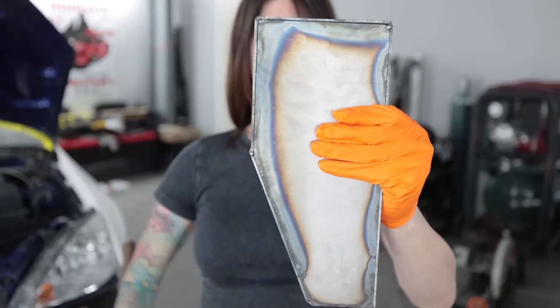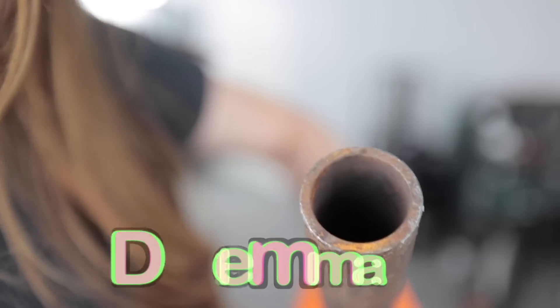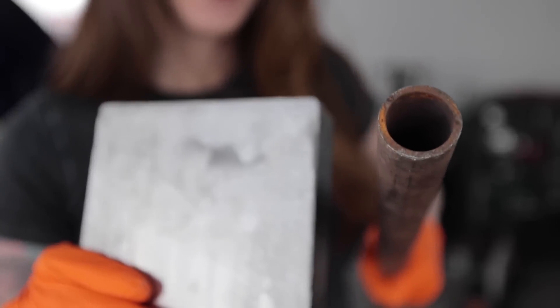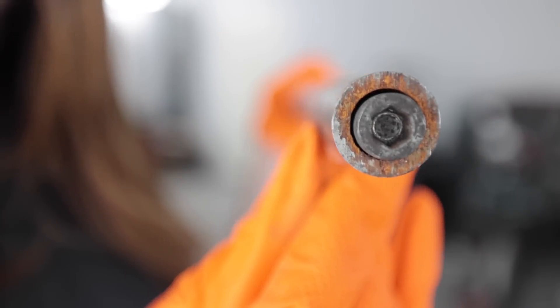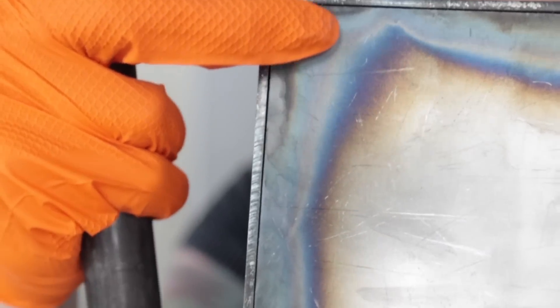In order to attach these to the front of the car they need to be bolted. The only way to bolt these and make the bolt heads not stick out and interfere with the bumper is to weld a tube on the inside of it — that's what they had on the actual WRC car. The problem is I have to use a big enough diameter tube to not only clear the head of a bolt but also a socket that has to fit around it. Solution is a smaller diameter pipe and the use of an allen head bolt, which means I don't have to worry about a socket. This also solves the issue of running the pipe too close to the edge because it's a much smaller diameter.